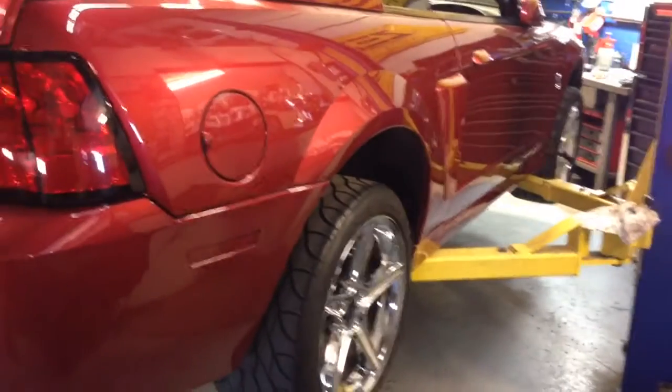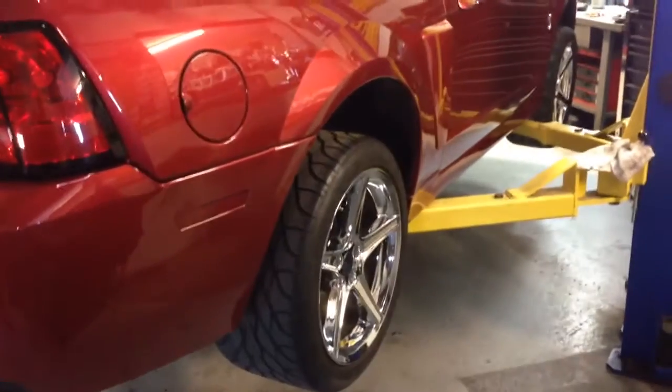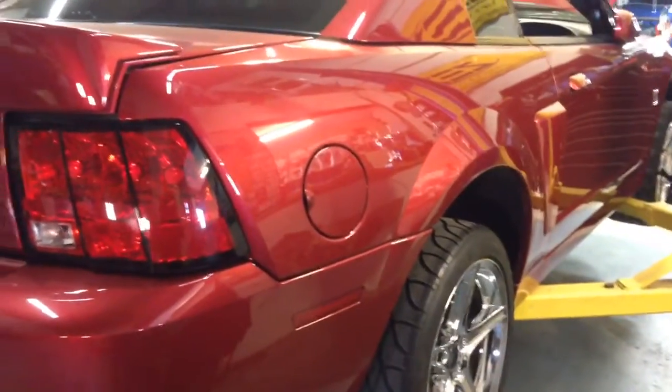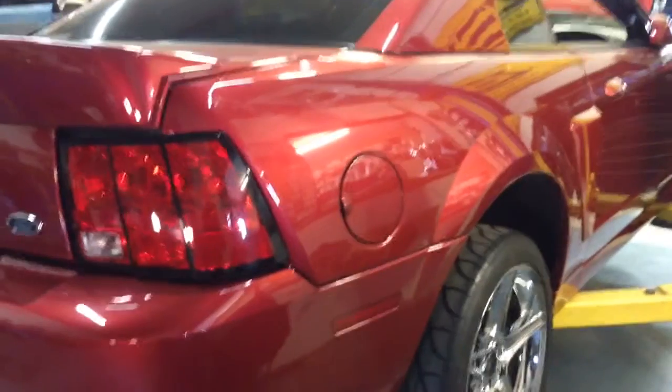This is a really nice, clean car — very nice. The paint is nice, wheels are sweet. It's dropped to the ground. Looks like it's got a pulley on it. That's where they put the voltage booster for the pumps — I don't know why they would use that. I don't even know what it is; it could be an MSD. There's no markings on it. So I'm about to pull the fuel tank and see what's going on with the fuel pumps and find why this thing has no fuel pressure and won't start.